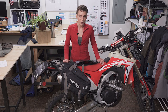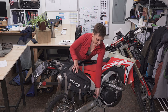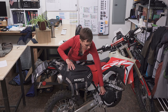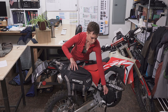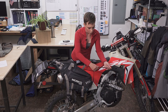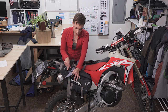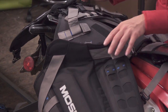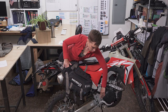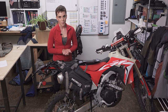Here we're working with a Honda CRF450L, which is a skinnier, smaller dual sport. I want to take a look at where this lower connection strap lies. What you don't want is the leg to be angled here and your strap pulling down in another direction. Ideally, you want a straight line going from the bottom of the leg holster to the frame of the bike, which is where most of the time you're going to be mounting. So as I'm looking here, I'm going to take a peek at where this arrow is pointing when I feel the harness is in its most natural position. That seems about right — I'm going to choose position number two, where I have a really nice angle coming up to the harness and going straight down to the frame of the bike.